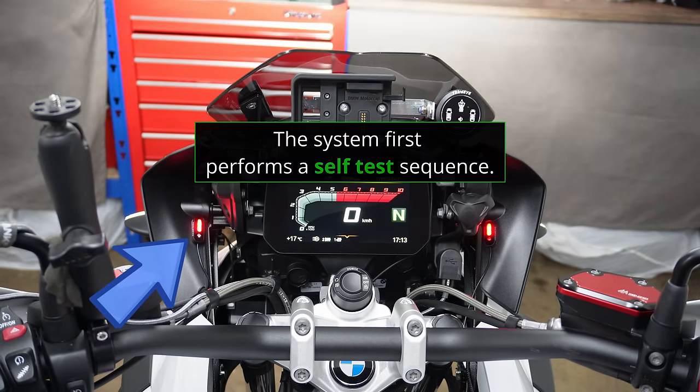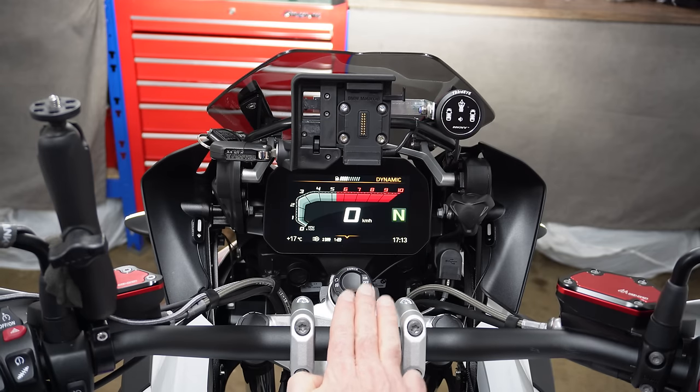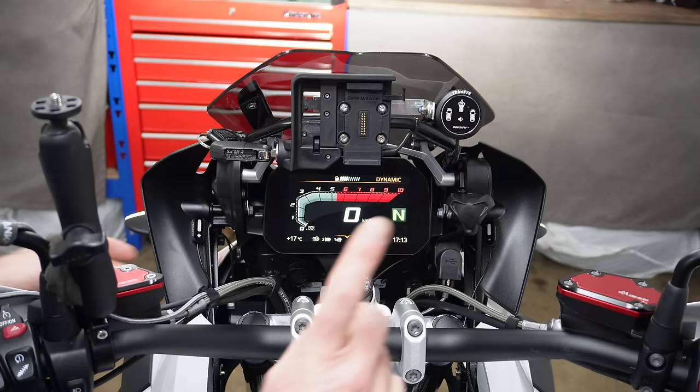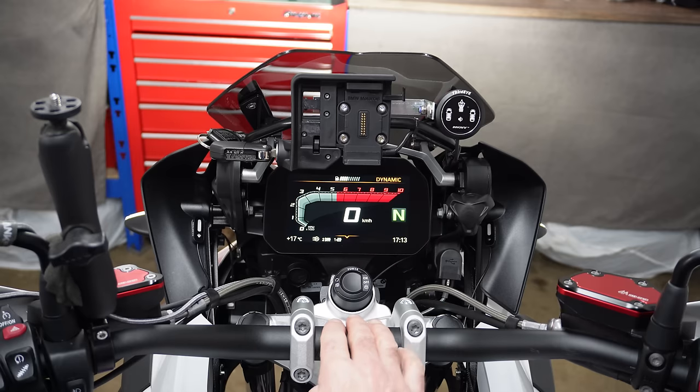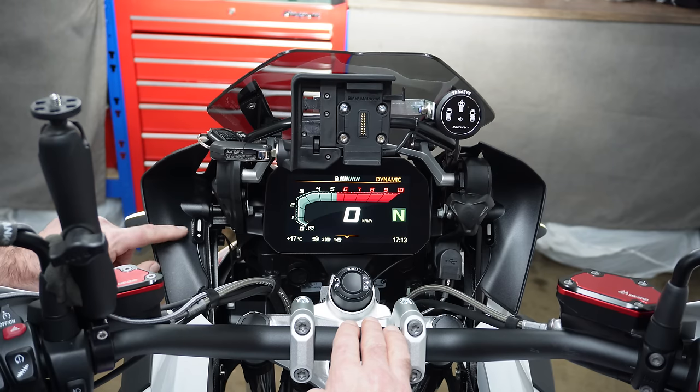Eventually I mounted the mirror LEDs on two flat panels on the small wing lugs, where the angle is almost perfect for direct eye-level visibility. Turning the ignition on shows the same startup sequence - flashing self-test followed by the buzzer sequence. To turn off the audible warning you press the button; one beep from the module under the seat confirms it's deactivated. Cable management is straightforward: with the TX25 screws on the side panels, you can run cables underneath the fairing, curl up any excess, and use a cable tie for a neat finish.